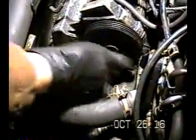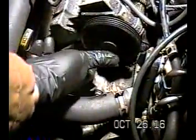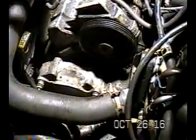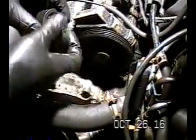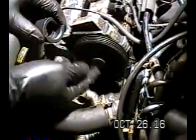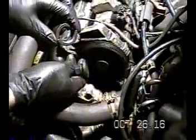Okay. All right, what I did is I took all these 10 millimeter bolts off, and I removed the pulley tensioner, and I removed the belt, which came out from behind here. So the tensioner's gone. There's two bolts that slide into here that hold the tensioner on. That's all away and put in a baggie. That's pretty self-explanatory. Now we got to pull the water pump pulley off, which is connected to the camshaft. I got a puller here, and that's what we're going to do next.